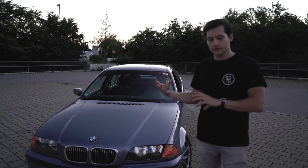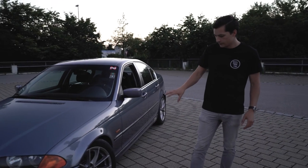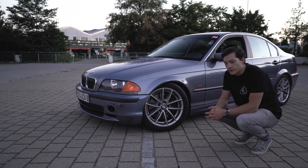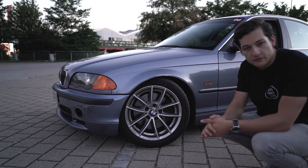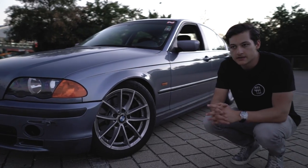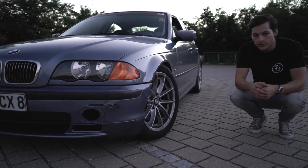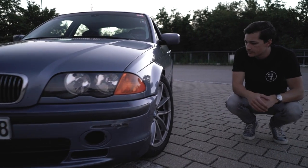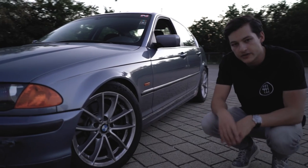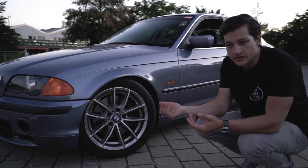We've got a different rear exhaust muffler which just helps a bit with the sound. Going to the front axle, we've got the brakes from a 330i E46, which increases the disc size by 25 millimeters compared to the normal discs. I've got the Target RS 29 pads, steel braided brake lines, and racing brake fluid which increases the boiling temperature. Tires are Michelin Pilot Sport Cup 2 — 225/45/17 square setup all the way around, which makes it pretty affordable. The set cost me just under 500 euros, which is pretty good for a semi-slick tire.